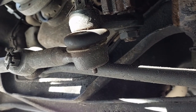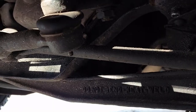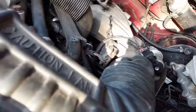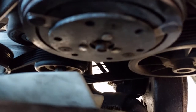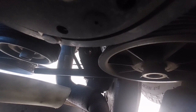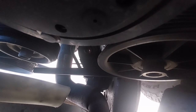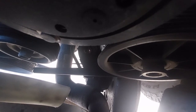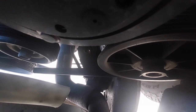There is an adjuster we're going to look at, located kind of on the top and side of the steering box. Looking right under the power steering pump, you can see the outline of a nut with a hex in the middle. What you do is break the nut loose, then turn the hex in the middle left or right until you get the adjustment you want, then tighten the nut — it functions as a locking nut.